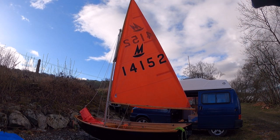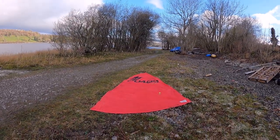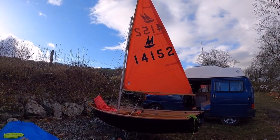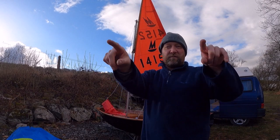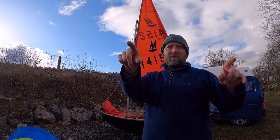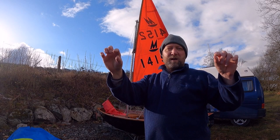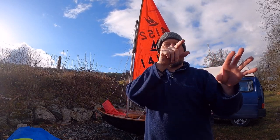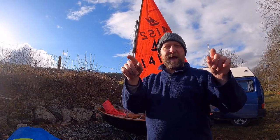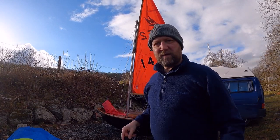What we'll do is then I'm going to also now measure the sail, which I can actually use the one I've got down here. That's why I was actually trying to work out whether they were the same size. So I can then work out areas of the sail, and I can then work out roughly where the sail needs to be lowered to get, say, 50% sail area, and then we can start to mark off where holes will need to go. And I could even punch holes out if I'm really careful to give them a little test to make sure the sail sits as it should do.